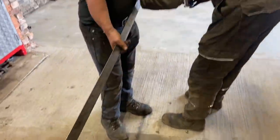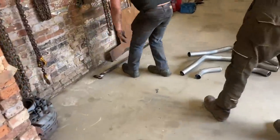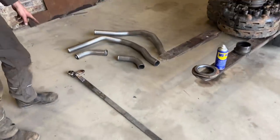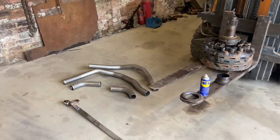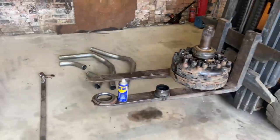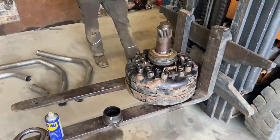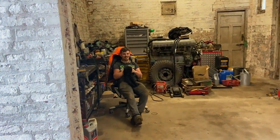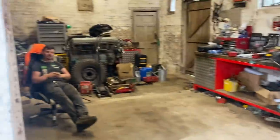This is our 'to go back in' pile - the build-up section. We've now got brakes, freed off the linkage that was sticking, and we've got the new water pipes. We just need the motivation to fit it all back in. The next job is to make up something to lift the clutch so we can get it back in square - everyone's told us it's going to be a nightmare, so we're going to engineer some sort of cradle. Or a ratchet strap - we are definitely going to engineer something.